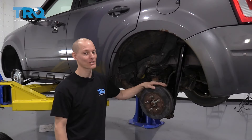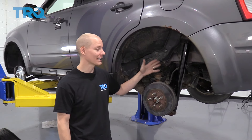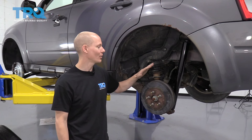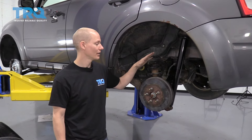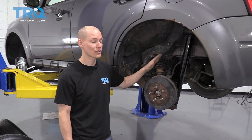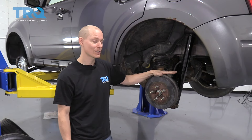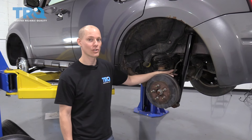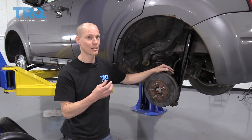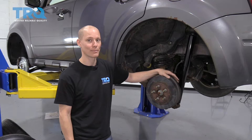Whenever you're replacing suspension components, it's always good to have an alignment done afterwards. In this case none of these parts are adjustable so an alignment may not change anything, but on many cars there are adjustments in the back to control rear wheel alignment. Whenever you're doing control arms on the front or rear of a car, or struts, always get an alignment afterwards so you know your wheels are straight. The last thing to emphasize: torque specs are important. A lot of these control arms have specific torque specs, and if you don't tighten them correctly, the nut can come loose and leave you stranded. Always follow the torque specs and get the job done right.